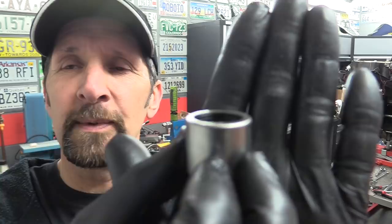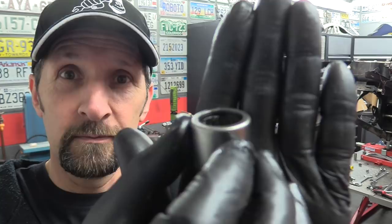As I said just now, the side you're pressing in on needs to be the flat side. But that is also the outside. That's the correct side to be pressing against, because you don't damage it, as I said. Also though, there's a rubber seal in there. If you take a look at that, to show that these are sided, that they go one way round and not the other, around the inside you can possibly see a little black rubber ring just inside the bearing. That's an oil seal, grease seal, little rubber seal.